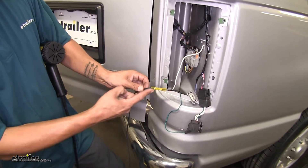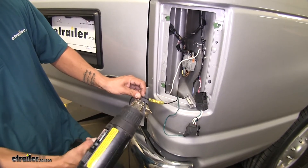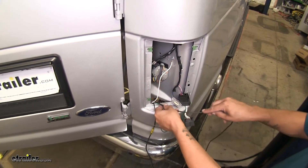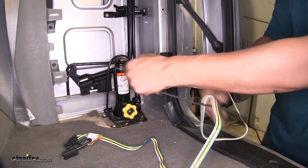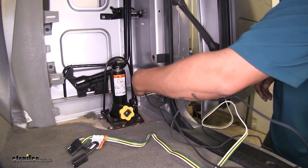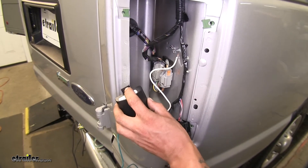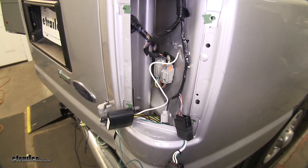If you're using an open flame such as a lighter or a torch, you want to be extremely careful not to burn or char the connector or the wire itself. We're going to want to take the free end of that black wire we just connected and route it in just where we had our four-pole wire as well. I'll pull all the slack out to make sure it didn't get caught — it's never a bad idea to peek on the outside and make sure it's all coming through. We're going to need to find a spot to mount our converter box. We have a couple of options: a tab we can screw into the panel, zip tie it to something, or use the provided double-sided tape. In our application, we're going to be using the tape.